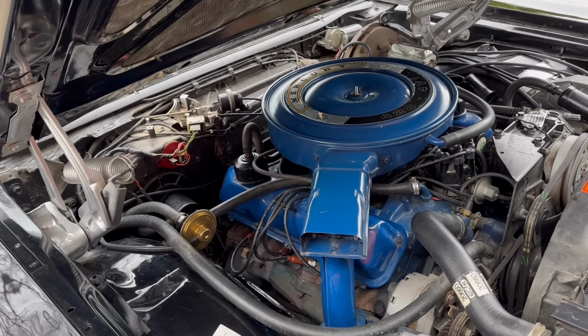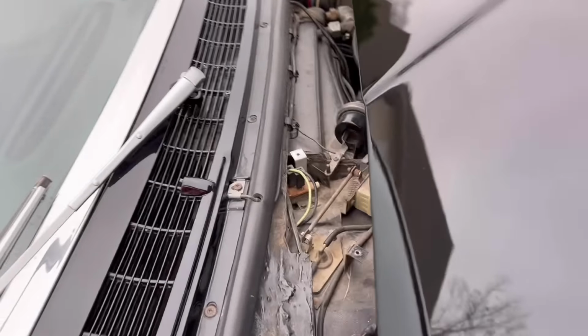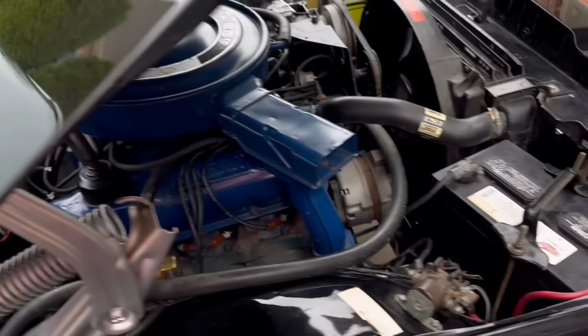And if I ever need to put the air conditioning on, this will work if I push it toward the cold side. It will move. You can also see the little relay clicking there. That's to turn the air conditioning compressor on and off. Kind of an interesting setup on these Fords with the air conditioning. But that's how that works. They have all these little vacuum diaphragms and everything to engage the air conditioning compressor, but it works well.